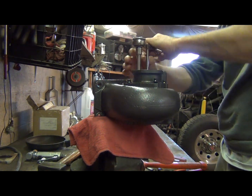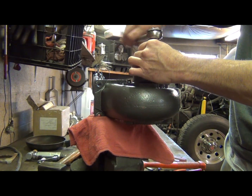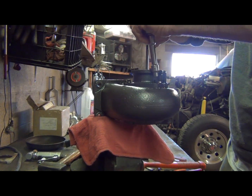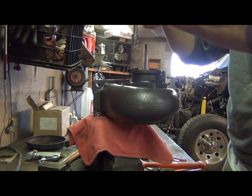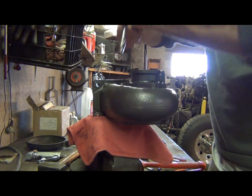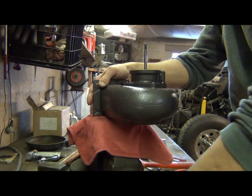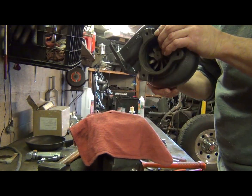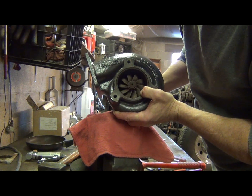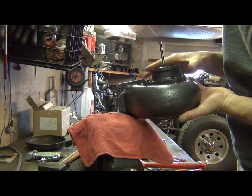I'm pretty sure there is a torque spec for this. I'm not going to bother to torque these down — I think I can use my own judgment on tightening it down. As you can see while I'm tightening these bolts, I'm still spinning this shaft. I don't hear anything rubbing. I'm happy with that — it doesn't feel like it's rubbing anything. Not too tight yet, no play with the new bushings and tension rings. You want to look in there and make sure your fan blades weren't rubbing, and mine are not. Go ahead and put this back in the vise — I'm going to pause the camera until the next step.